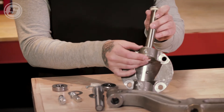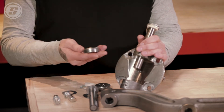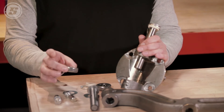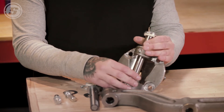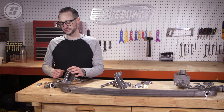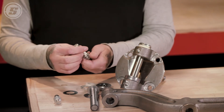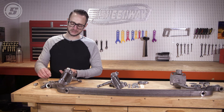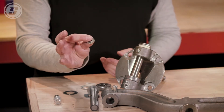That cap and felt washer is going to go on your kingpin first and slide up, then you'll fit it into the kingpin. You're going to slide the kingpin all the way through the axle. The bearing has two sides — one side is flush, the other is where they put it together. You want to keep the flush side up to keep the elements out of the bearing. Line up your kingpin locator notch, install it, and it may take a little tap at the top to get it flush so you can put your locator in. Put the threaded end of the locator into the axle first so you don't see the nut from the back side — it looks cleaner. That's going to lock the kingpin into your axle; then put your washer and nut on and tighten it up.